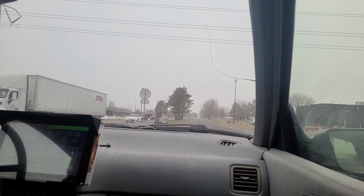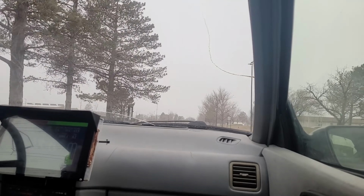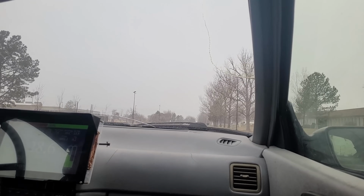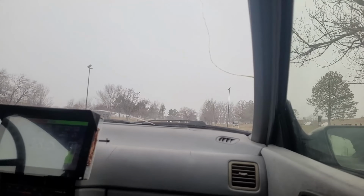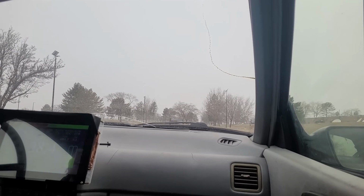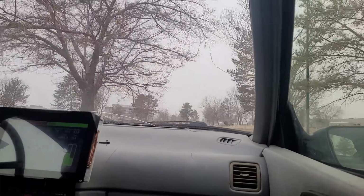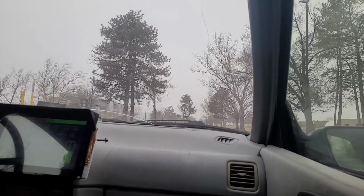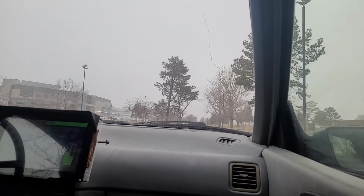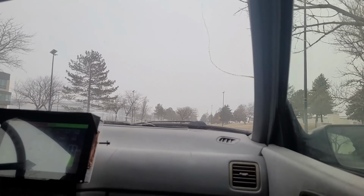All right, so since this car weighs about 300 pounds heavier, that's obviously gonna make it slower on the 0 to 60. But with the electric motor, it's got like 110 foot-pounds of torque compared to about 60 on the stock gas car. So it's got double the torque. And then the power on the motor, at peak, I think I'm getting about 40 horsepower into it at peaks, which is less than the 55 that the gas engine had. So increased weight, but better torque and slightly worse power. So I think my 0 to 40 is going to be significantly better than the stock gas car would. 0 to 60, I think I might come in at the same or maybe even a little slower.